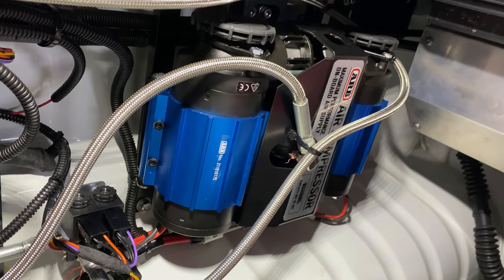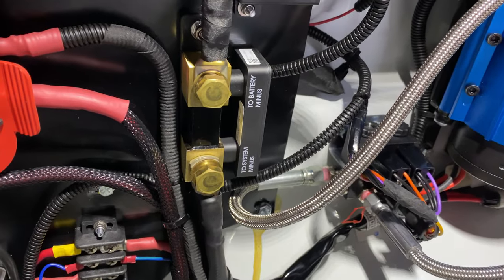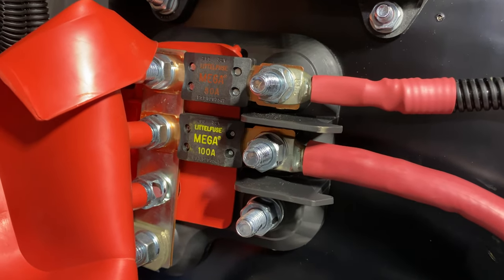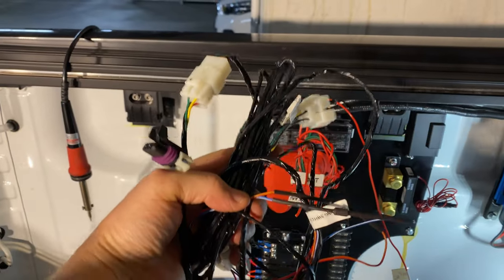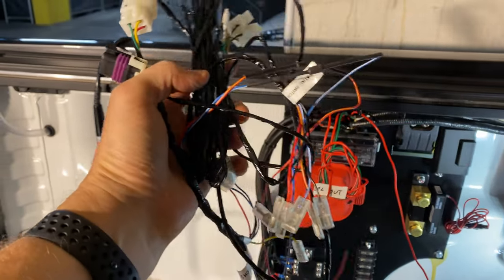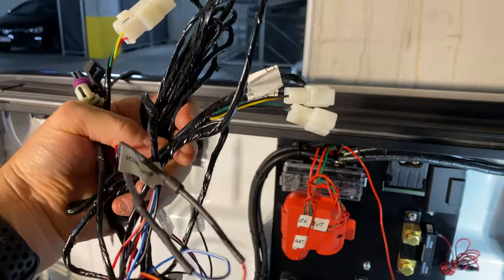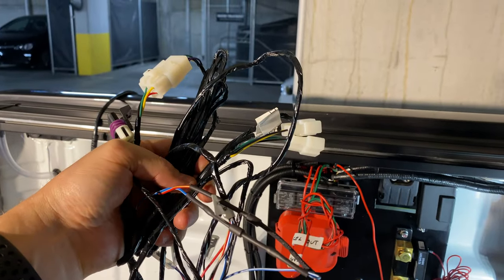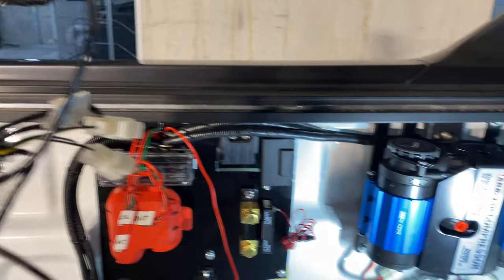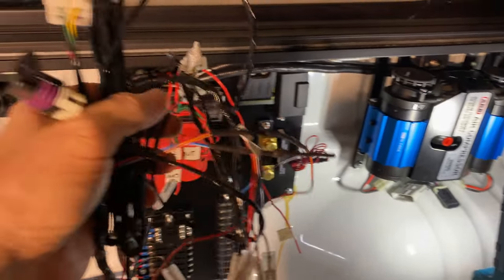Your main power cables for the compressor — your negative is hooked up to your body source, and your positive is power supplied. I've cut out the 40 amp fuses and put in a single 80 amp fuse. All of this is the mess you get with the ARB stock wiring, which includes the ability to switch solenoids for your dual air lockers. If you just want to turn it on and off, then all of this is unnecessary.